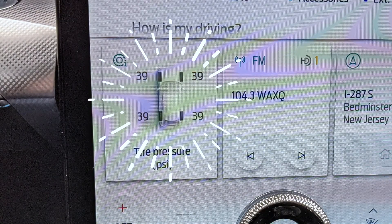First of all, we set the tires to the recommended tire pressure that the manufacturer has for the vehicle. In the case of this Mach-E, it's 39 pounds per square inch. We set all the tires at that cold this morning. We also check the speedometer according to GPS to make sure, because many speedometers aren't really 100% accurate. The Mach-E was dead on — 70 miles an hour showed a constant 70 miles an hour to GPS. So we have the adaptive cruise control set at 78 miles an hour. I checked my wind app — very little wind today.